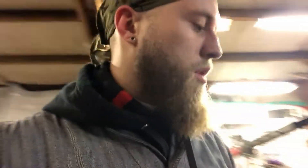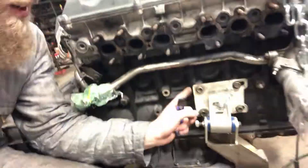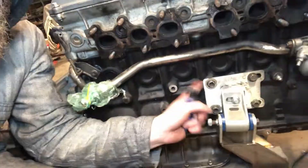I got the transmission all bolted up and the clutch in there. Next step is finishing up putting the slave cylinder in. Once the slave cylinder's in there, we're gonna go ahead and throw it back into the 280. I'll make a bracket for this little spacer — hopefully it'll fit, but we'll find out. We gotta build a spacer for this bracket, space it out so it'll actually fit and hopefully be straight.